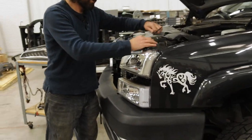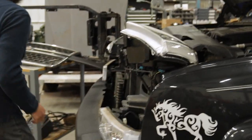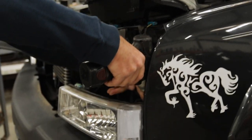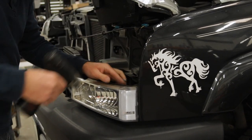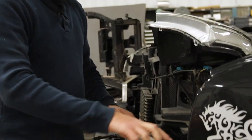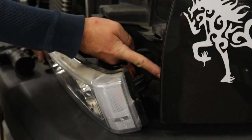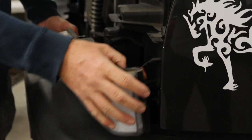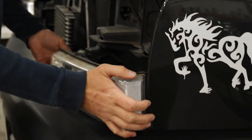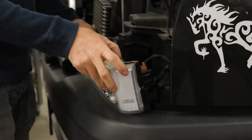What we need to do is pull the headlight on this one. If yours is like mine you had to run a screw to keep this from popping out. If you don't know this little trick — the way these lower ones mount, these ears, when they snap into place, a lot of times that plastic will get weak and it'll start popping out. If you just take a standard little self-drilling screw and run it down, it'll keep it from popping out so you don't have to go buy new housings if that's the only issue.